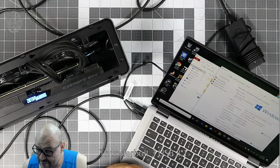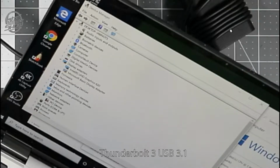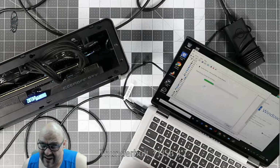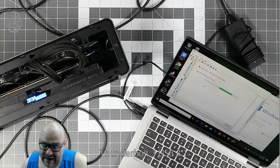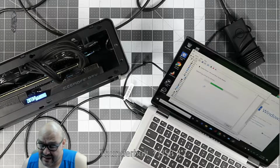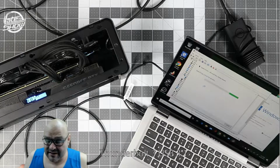We're going to go to the drivers, the device manager. If you guys can see it, it's in there now. It's coming up now. So we're going to go ahead and update the driver, search. It'll automatically install the NVIDIA if it finds it. I mean, most of the time it finds it right away. But sometimes it takes some time. It depends on your internet.